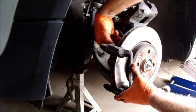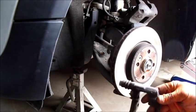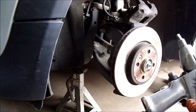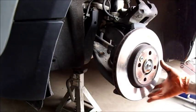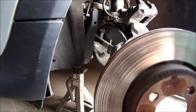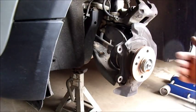I'll remove the bottom bolt, and there's the top bolt — those are the same length. I'll set the bracket aside. Then I have my 3/8ths impact that I will use with the T50 Torx bit. And remove that bolt. As you can see, the rotor just comes off with it — and that's got a lot of wear on it. You can see the grooves in it.